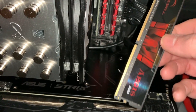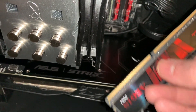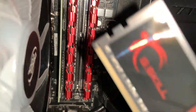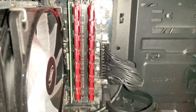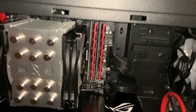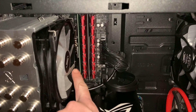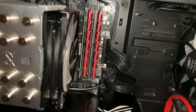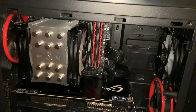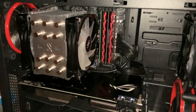When installing new DDR4 RAM, you can see there's a little gap in the pins. An easy way to check orientation is to look at the socket — there's a spot with no pins, and that's how you know your alignment is correct. The RAM is installed. It's almost invisible because they're old school sticks with no heat spreaders — one just has a sticker and the other has nothing. Hopefully we can boot up and get 32 gigs of RAM.